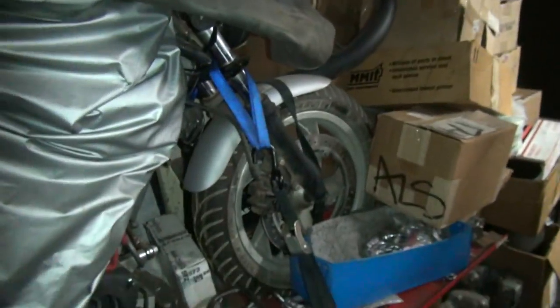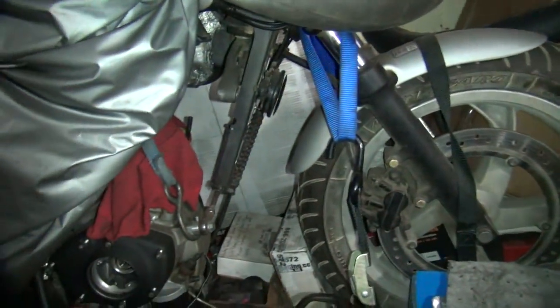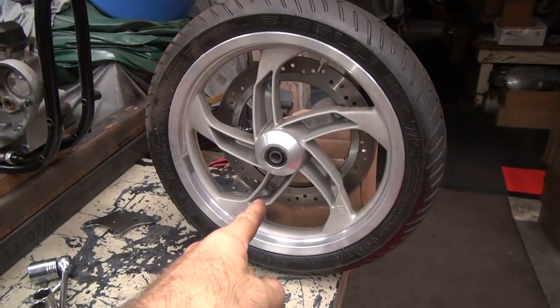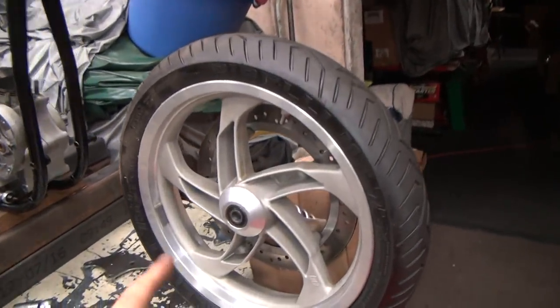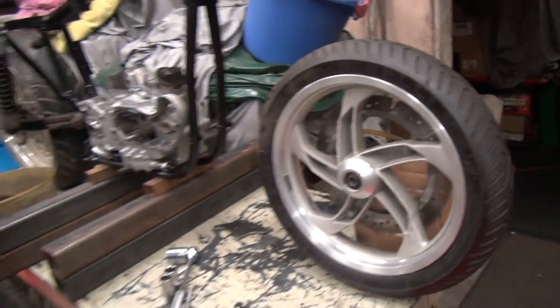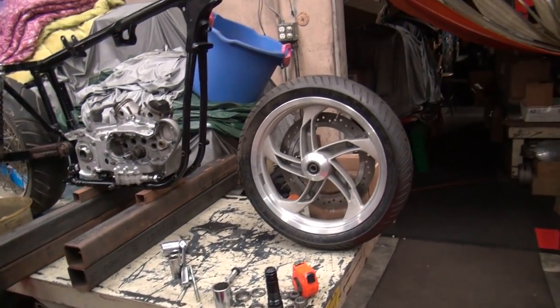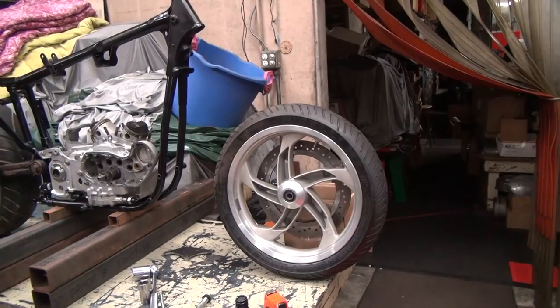So this is my Buell Blast here, my other race bike. And there's the same wheel over here on this bike. This one takes a little stubby front end, so he's getting a 32-inch front end length, which is about what this bike would be if you had this small tire, about 22.5 inch diameter. Most sport bike tires are in that dimension, 22.5 to 23 max. So you've got a good selection of rubber, 17-inch stuff like that.